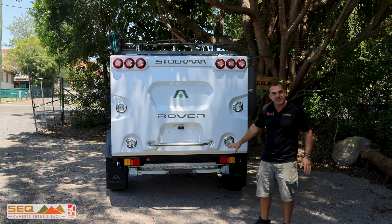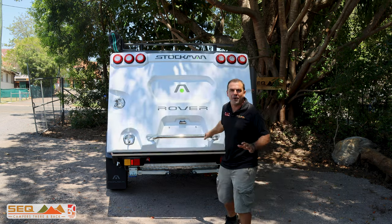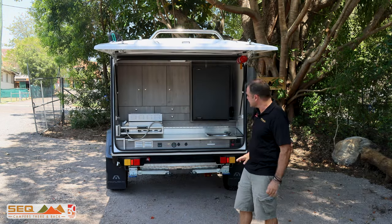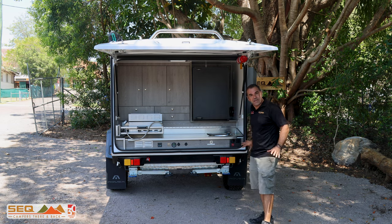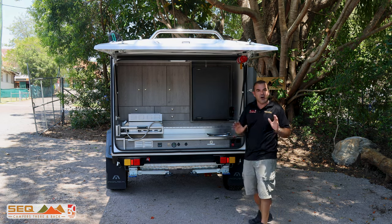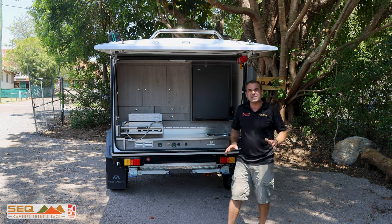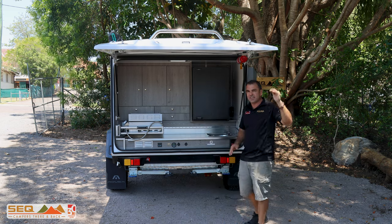The new Rover with airbag suspension. I do have legs I can put down, but we'll quite often set this up here without having to use any legs. We've now got airbag suspension — it's all set up here in the corner with the airbag manifold and onboard compressor. I can just turn it on and off here. As a pro tip, we never really want to have our airbags above 40 or 50 PSI.